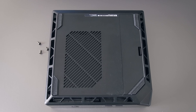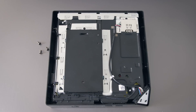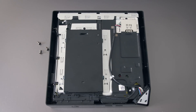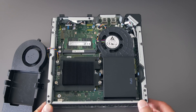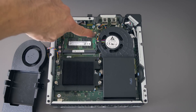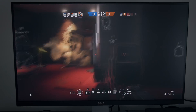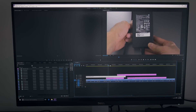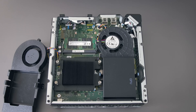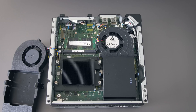To get inside the Alpha, it's just four screws. You remove the cage and get access to the 2.5-inch drive bay. You can swap it out for an SSD, and flipping it over there's actually room for a second storage drive — this is new for the second-gen Alpha. It's an M.2 PCIe slot and it brings a lot of extra functionality. If you want to record gameplay, edit videos, or just want more storage space, having a second internal drive is really nice. You also have access to the single-channel RAM slot — I'm running 8GB, but you can replace it with a 16GB stick.